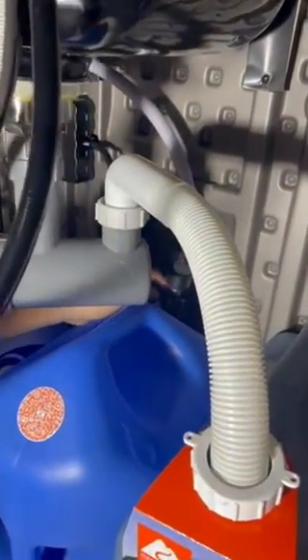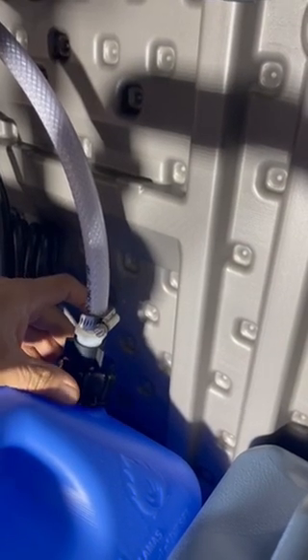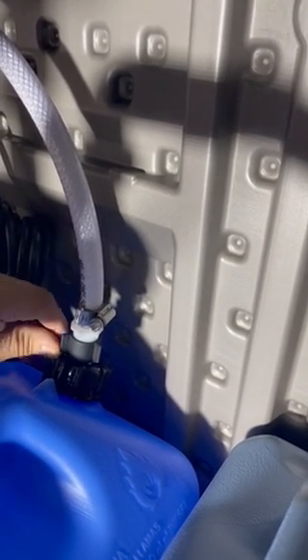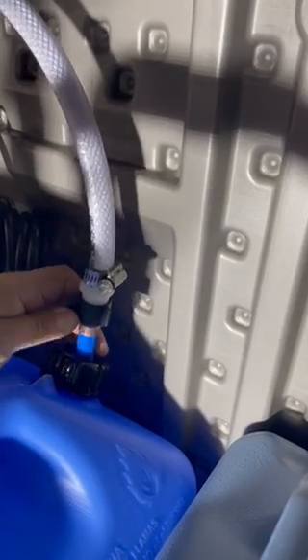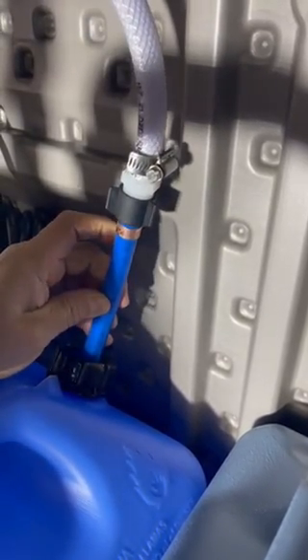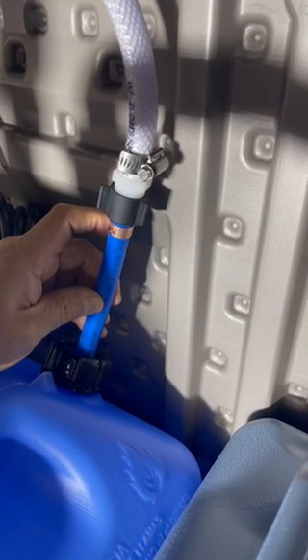This is the problem right here. This unit is all set up right now, and the black nut on the blue hose and the black nut on the water supply jug are almost touching one another. We're getting a lot of calls where this blue hose isn't in far enough and it's sticking up — when that happens, you're sucking air.